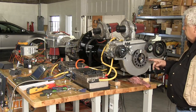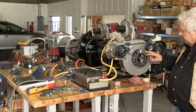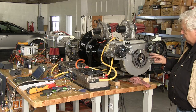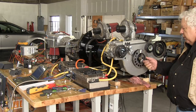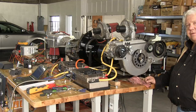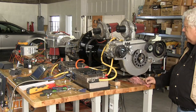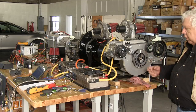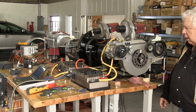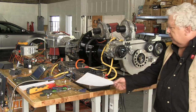And so when the motor turns, it drives these units, but it also passes this reluctor ring. One problem with that is we don't really have a way to take a standard tach signal off this end of the motor, so we've had to install one elsewhere to feed our Soliton 1 controllers. And let's take a look at how we did that.